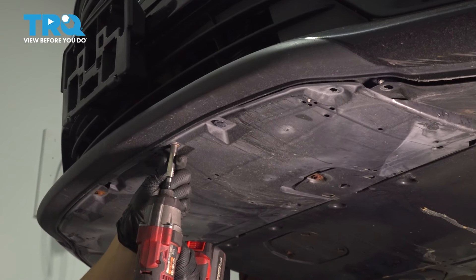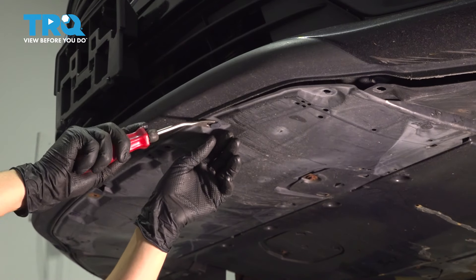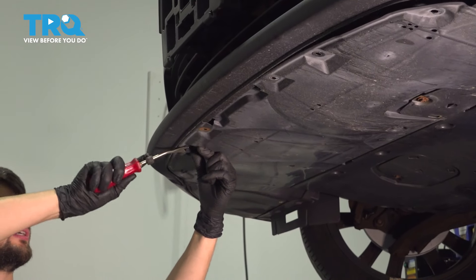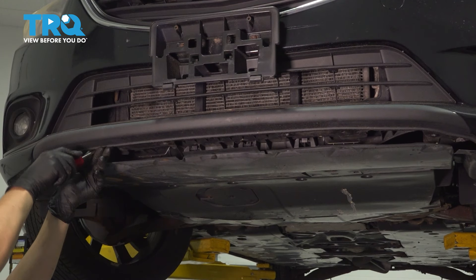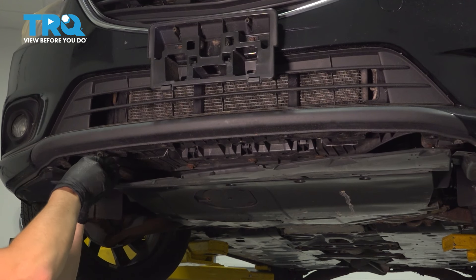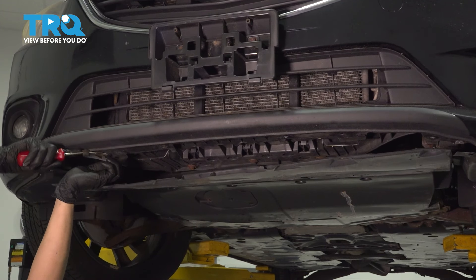There's a push clip here that we'll come back for. There should be three more screws on this side. Let's get the two push clips that were here. Hold the shield so it doesn't fall down suddenly. Looks like it is also hooked in over here. Underneath this shield, you'll see two push clips that are kind of hiding in there — here and here. We have to pop these out, otherwise the bumper will be stuck on the bottom here. These are kind of gummed up with sand and debris, so a lot of times they're difficult to remove. If you break them, you're going to have to source new ones. Just work them back and forth — eventually they should break free and come out.